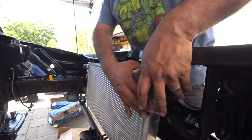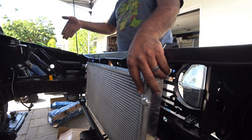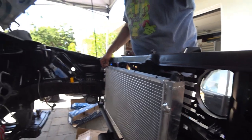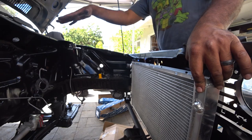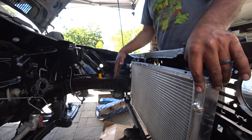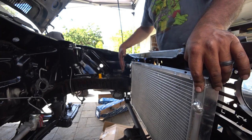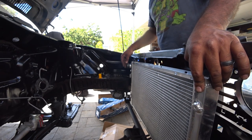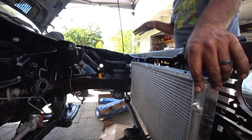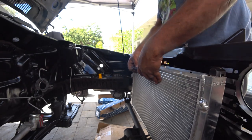The reason you go to a Mark III radiator is mainly because the coolant lines are on the driver's side — just like a Mark IV. So when the 1.8T goes in, you can actually use the factory Mark IV radiator hoses to line everything up correctly. You're going to do a little bit of fabrication, but nothing crazy, and when we get to the point of installing the motor again, I'll show you what I mean.